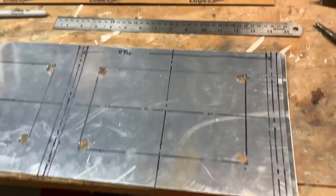In this episode, I'm starting out in my basement making new inspection panels that go on the inboard trailing edge of the wing. That's where you have to connect the aileron and flap cables, and usually you only have two little holes to get your hands in. It's very hard to connect anything just by feel, so I talked to my mechanic and he agreed this is something I can do.